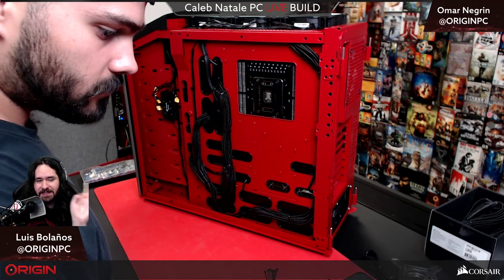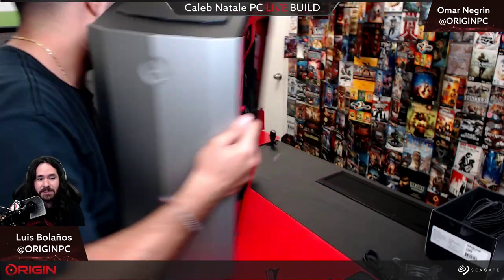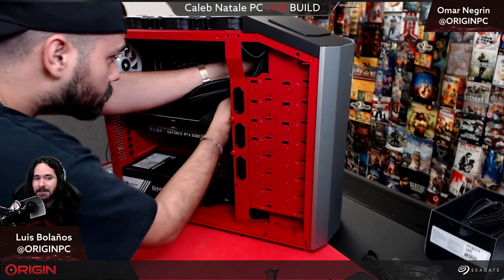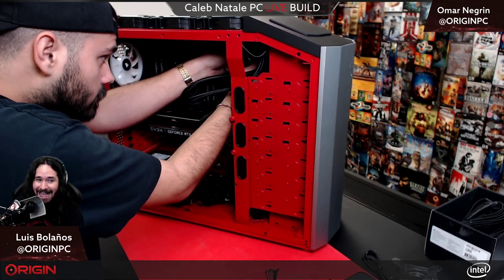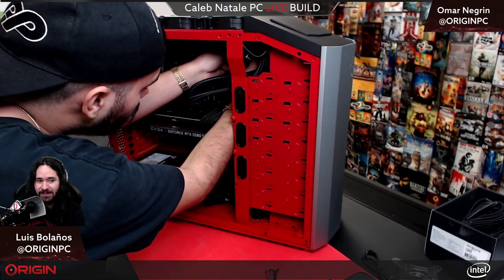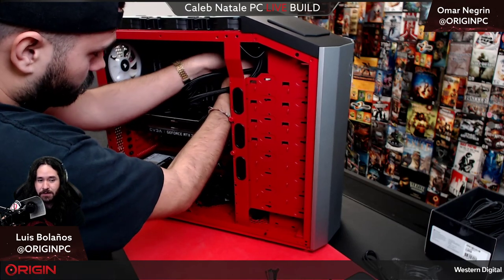Your second gen i5 is still solid, but if you up your GPU, you would definitely get more performance. That's without a question, especially for Rainbow Six. I think if you can score a 1060, for sure you're going to see a performance difference. That i5 second gen could probably last, but you're nearing the edge of the lifetime for it. You can only get a little bit out of it. And some games, I know for a fact PUBG might have issues playing that one, but Rainbow Six, I think, should be okay.